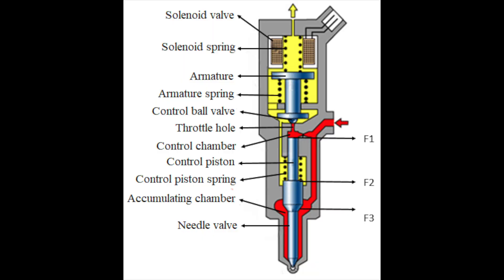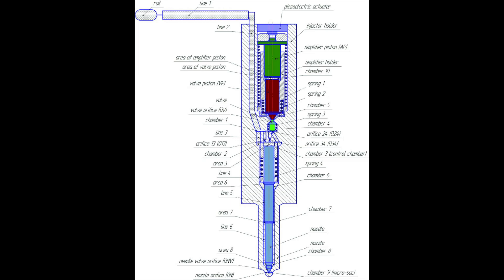The N55 is a much more reliable engine than the N54, however it's still not without problems. The main issue is fuel injectors needing replacement. N55 injectors are a solenoid style, compared to the N54's piezo crystal style. The main difference is that solenoid injectors are significantly cheaper to replace. Both engines will need injector replacement at some point. The N55 also has an electronic water pump that fails over time — specifically, the control board inside the motor fails, not the permanent magnet motor itself, which is very reliable.